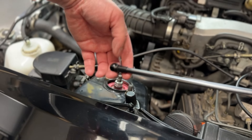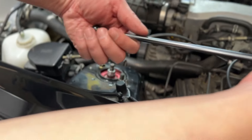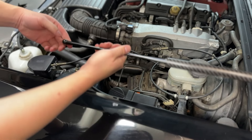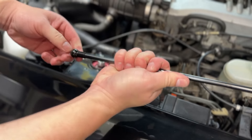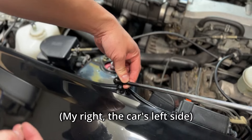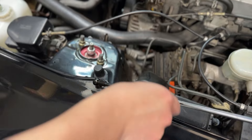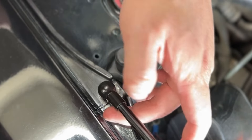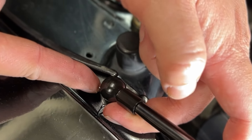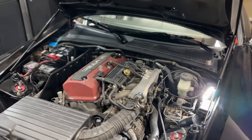This end may not necessarily line up right away — you can see the hole is pointing outwards towards the driver's side, so you need to grab the whole thing and rotate it. I rotated the rod pointing down so it'll line up with the stud. Release the retaining clip, and since it's not lining up quite right, lift up on the hood until it lines up. Pop it down into place — the hole ends up kind of far downward. The end of the retaining clip is poking through, so swing it over and lock it in place. Both are now installed.